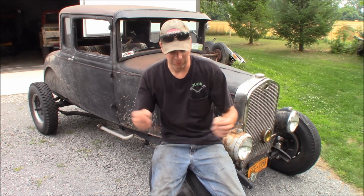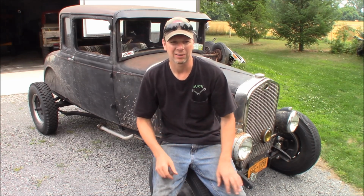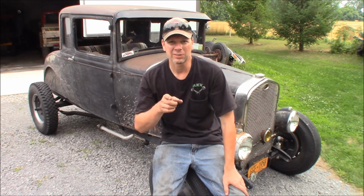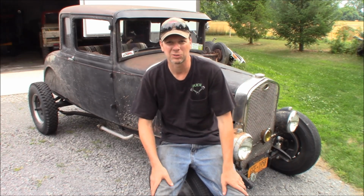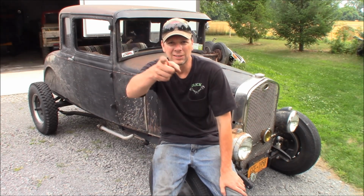And so I'm going to have to dig up a 12-volt coil and swap that out. I'm also going to check the integrity of the wire that feeds the coil to make sure there's no spot where it's grounding out and blowing the fuse. But the coil was getting awful hot, like you put your hand on it. So I'm going to guess that the coil is the problem. But I'm going to have to dig out some parts and get that fixed. So I just wanted to throw this in at the end, that the issue isn't fixed. You can't just magically fix broken fuses by putting more of them in, because there's probably a reason why they're blowing. So now cut to the outro.